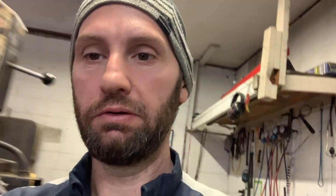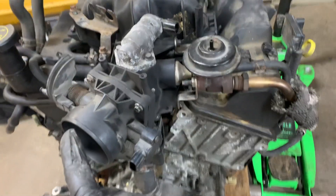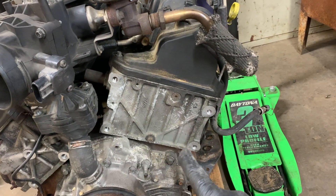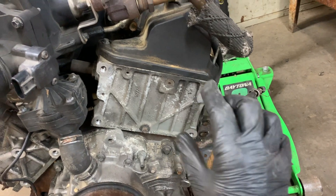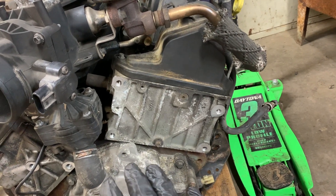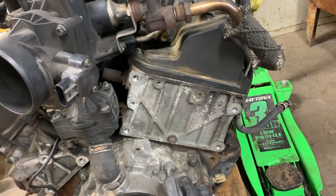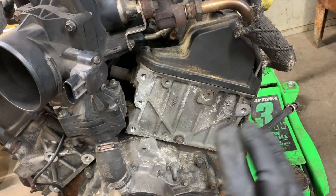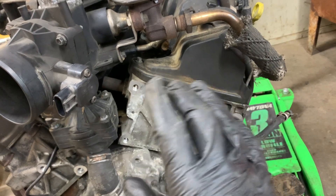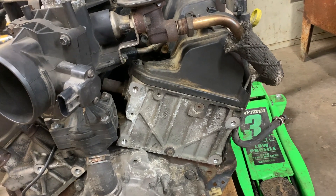I just put an engine in this thing — here's the old engine. This is where the alternator sits, and that wiring harness runs down through here. There's a big bracket that bolts in here and the wiring harness runs right through it. What are the chances I pinched that wiring harness somewhere in this area and it's shorted to ground? I'm going to have to take off this big bracket that holds the alternator and power steering pump and inspect the wires.